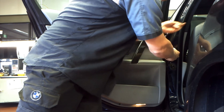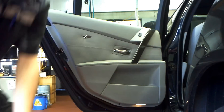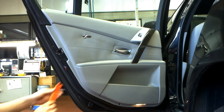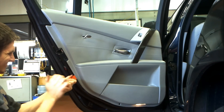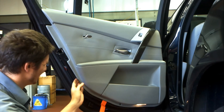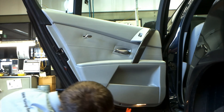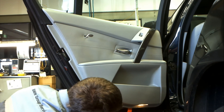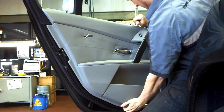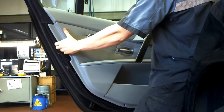The other trick about this door is that it's got one big middle clip. Normally I would have also expected the trim behind the door handle to come off or something to be behind that, but no, again not. I just sort of work my way around the outsides using my plastic trim removal tools, because otherwise you scratch the paint off the door — just working off the clips on the outsides, being careful not to bust anything.